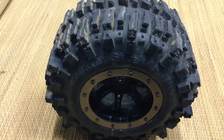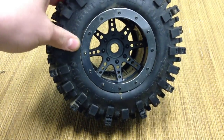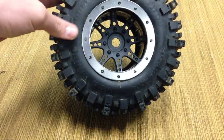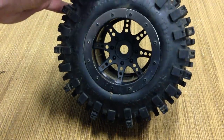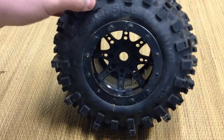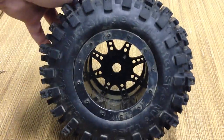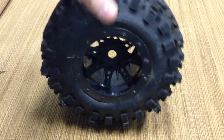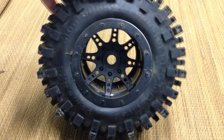Con number two of these mud slingers — if you've watched my beadlock video on how to install beadlock tires, it took forever to install these beadlocks. You have to put the rubber underneath the metal ring, put the screws in a certain order, then tighten it all down. It just takes time, especially if you have a small allen wrench like I had at the time. These rims are also double-sided beadlock, which looks pretty cool but really destroys your fingers and takes quite a bit of time doing all four tires.